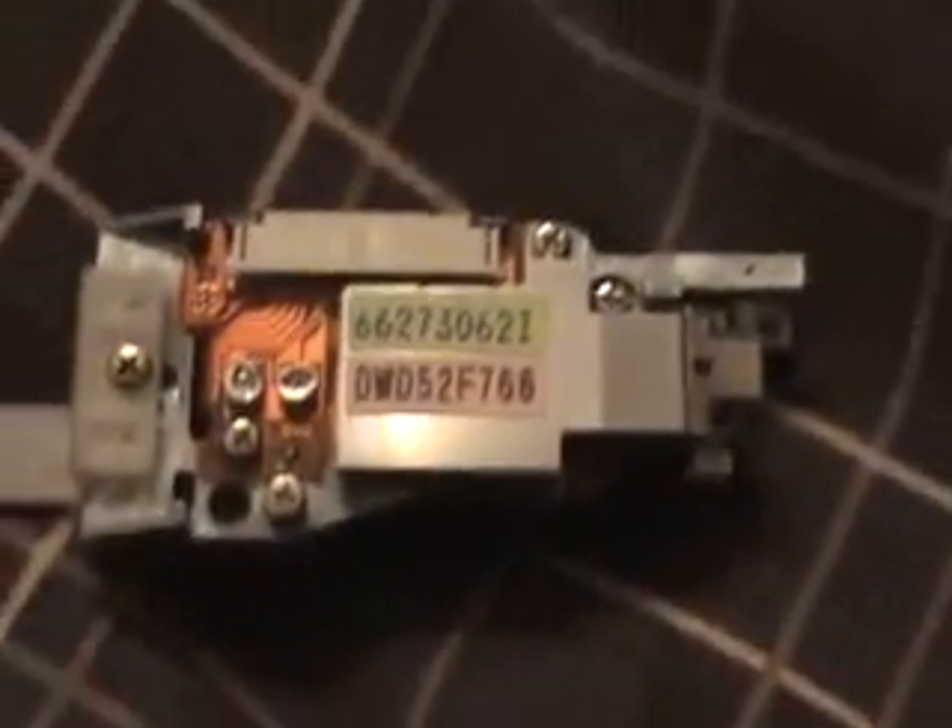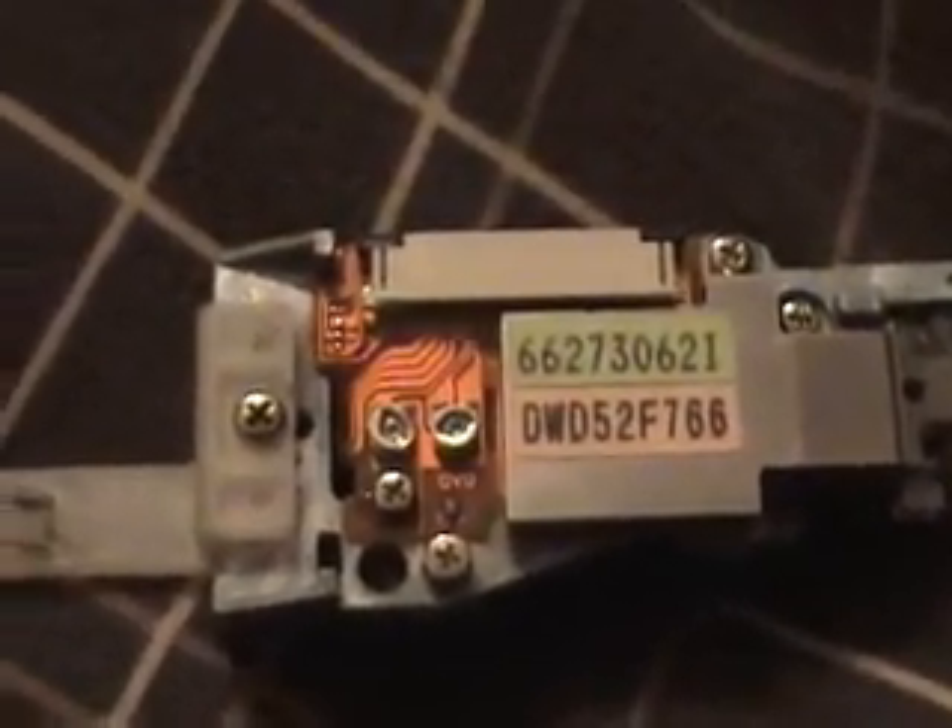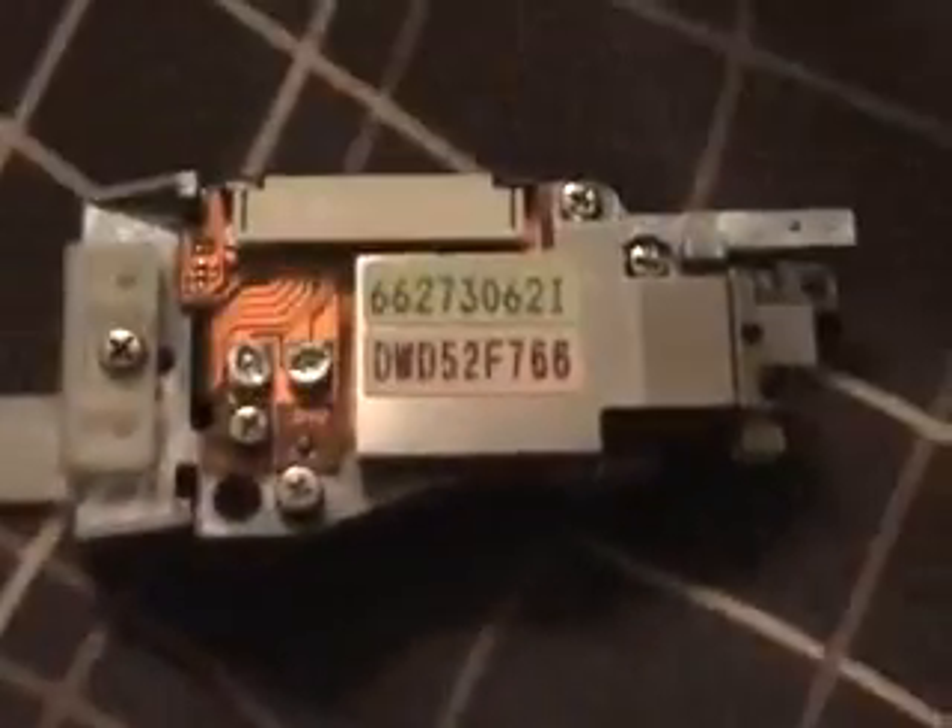This potentiometer is for DVD, which covers most PlayStation games. This one is for CD, which is for blue-back discs. Put your screwdriver into the slot and twist clockwise for more gain or anti-clockwise for less gain. More gain gives the laser more power but burns it out quicker; less gain makes the laser weaker and it may not read discs at all. It's best to turn them a few degrees at a time, reassemble the PlayStation, and then try to read a disc — going too far can shorten the life of the laser significantly.